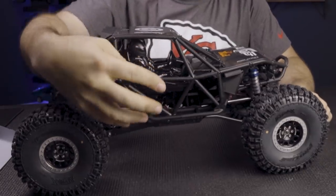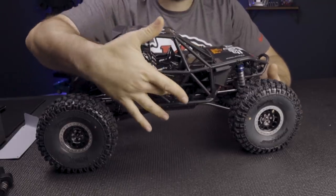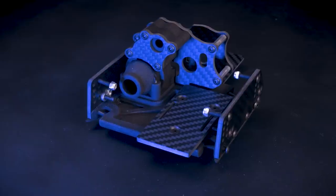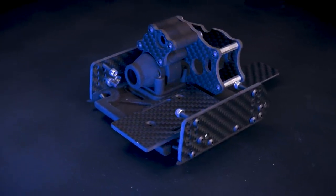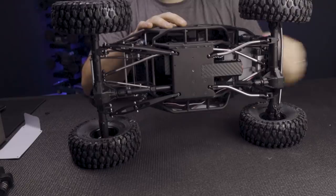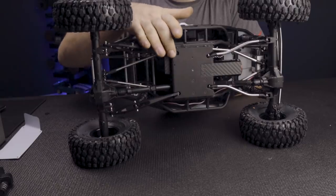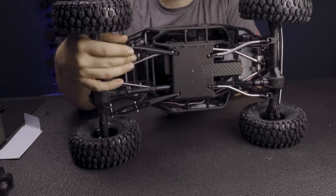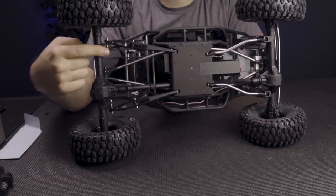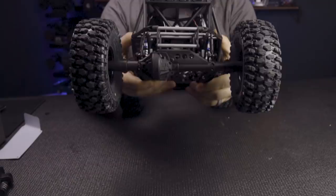This assembly takes that heavy motor option and puts it all the way to the front. The skid plate and transmission setup also has a tray on the passenger side that can be used for a small battery to keep your center of gravity nice and low, or you can still utilize the front-mounted battery setup. Also, this skid plate pushes the trailing arms all the way out to the edge and angles the mount. I noted in the last video my shock angle, and now by spacing the trailing arms to the outside of these link mounts, it corrects my rear shock angle so they're more up and down — which is going to work out perfectly.